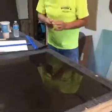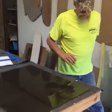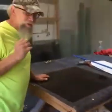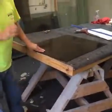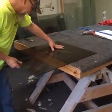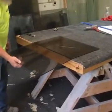Now, cutting glass is kind of like MIG welding. I don't have to watch to know if you're doing a good job on the cut. It's that sizzle. When you're welding, it's got a sizzle that just sounds right. When you're cutting glass, it's almost a sizzling sound. If you're doing it right, it's working pretty good. I put a little pressure. Now this broke. I've got it broke. Now you can see it's coming down.